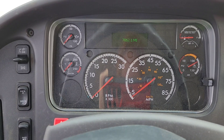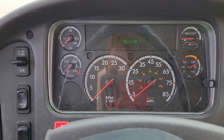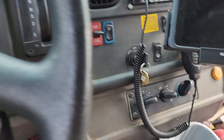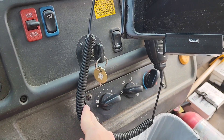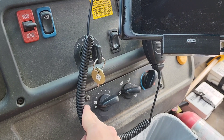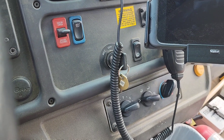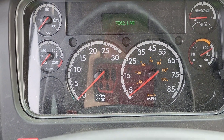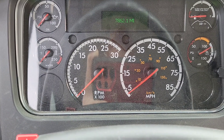It's also a warning to stay away from the exhaust, as temperatures can reach over 660 degrees, which is extremely hot. If you need to cancel the regen at any time, all you have to do is push on the brake pedal. It is highly recommended that you do not shut off the engine during a forced regeneration — you want to stop the regen first, as your engine is going to be ramped up. It's always best to shut it off at low idle.